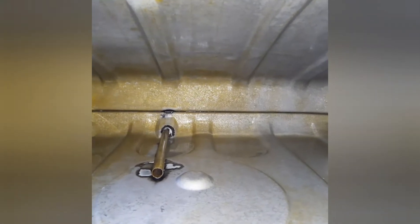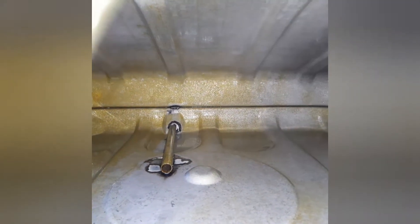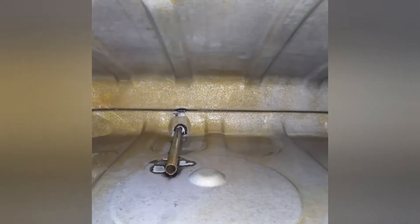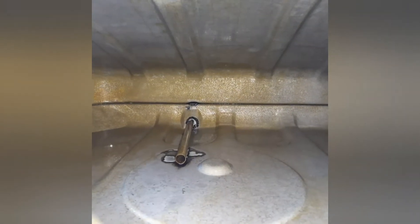I'll show you inside the tank now - I've just given it a rinse out. As you can see it's pretty clean, but see that rust there? That's already forming. I've just washed it out this morning with acid - my second wash - and rinsed it out with water. It's coming back so aggressively because there's obviously not much galvanizing or zinc coating left on the inside of this tank anymore.